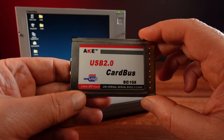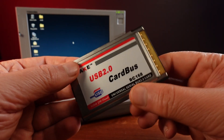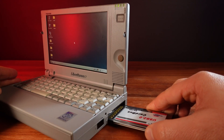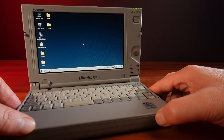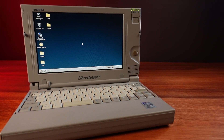But probably the most useful PC card I have is this USB card with two USB 2.0 ports. This gold strip with the eight grounding bumps indicates this is a 32-bit PC card that will only work in compatible slots such as these two. It can't be used to boot from USB, but it should be able to do everything else that you'd expect a USB port to do. This Libretto has no USB ports of its own because it came out just as the USB 1.1 specification was being ratified. Almost no computers at that time included USB yet.